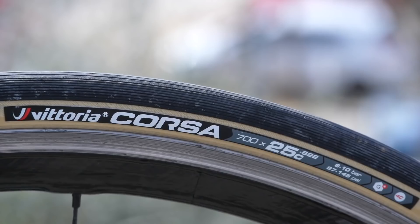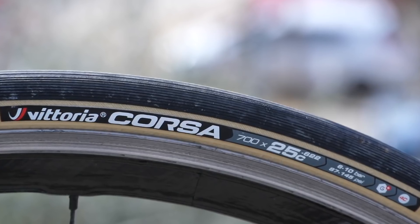It comes in from John Potter who has skin wall or gum wall tires and wants to know if they're more susceptible to puncture. Those tires traditionally have a casing made out of cotton rather than nylon, meaning they're more lively than a cheaper tire. Cotton tends to be used on more premium tires, offering better flexibility — so if you encounter a bump or stone on the road you go over it more so than with a nylon tire.